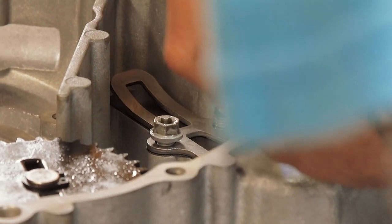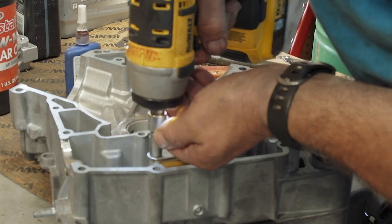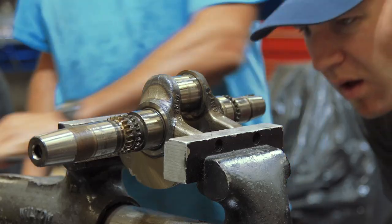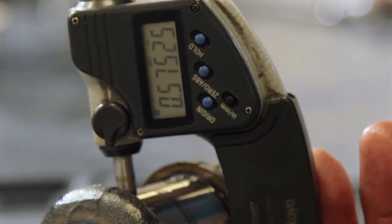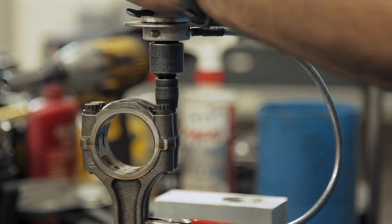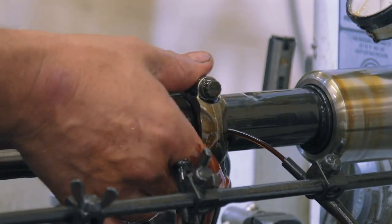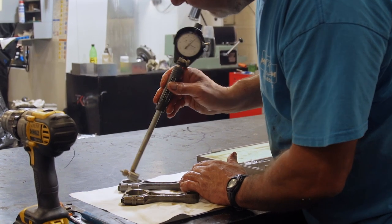The 860 kit is a real good value bang for the buck. It's got stock-style cast pistons, not much more than factory pricing, and gives you a real good bang for the buck compared to the 975. It gives you a little bit more displacement than the stock 800 and a little bit more compression for hardly any more money, which is why we went with that on this build. We could have gone with a 975 but since we're not spraying it, there's really no need.